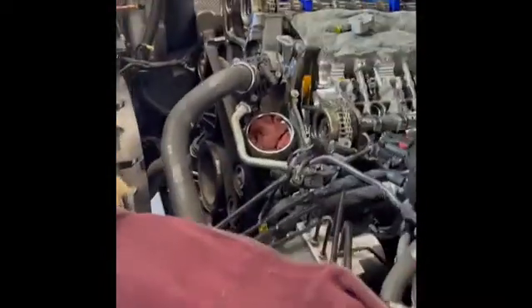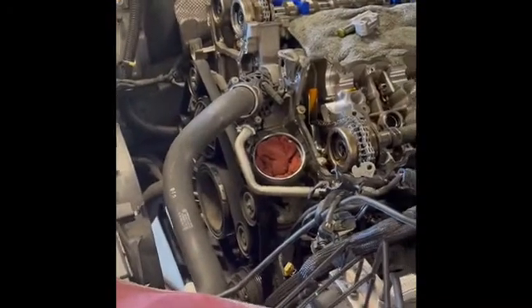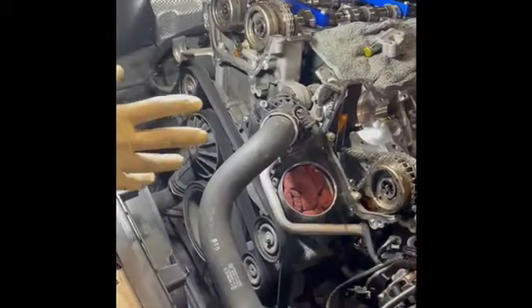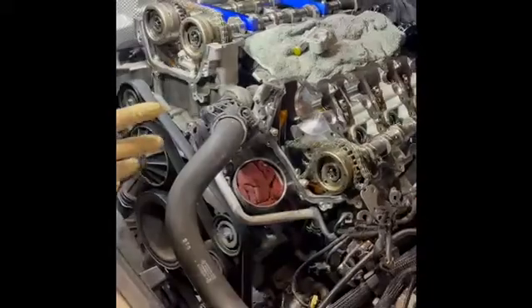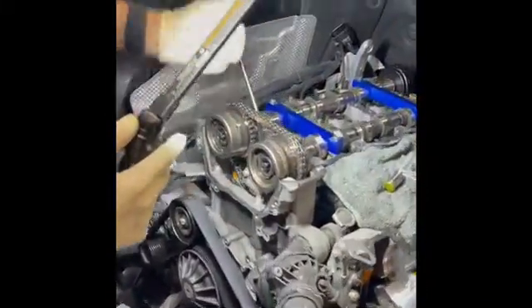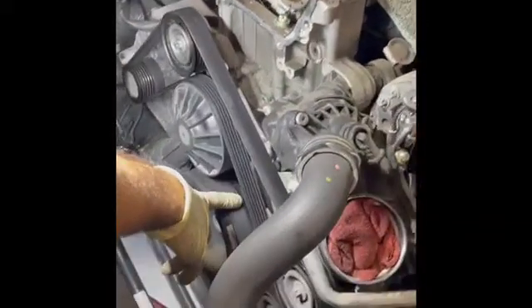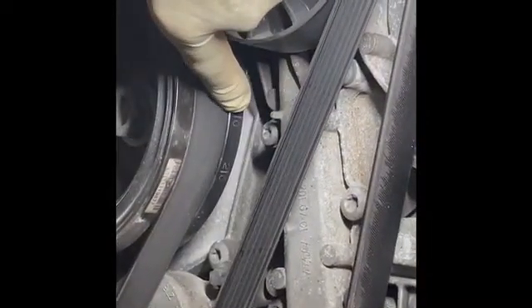The other thing I want to talk about is the timing markings, because I noticed there's a lot of information missing about the difference between the timing marks. This engine is set to base timing at 40 degrees after top dead center — meaning cylinder one piston is all the way at the top and starts going down 40 degrees after TDC. The marking on the M276 is on the crankshaft, and there's a little edge which I'm touching right here, and as long as this edge matches the 40-degree mark, you're in position.